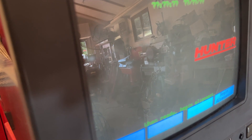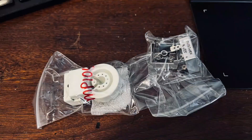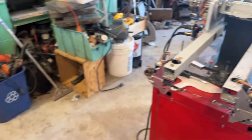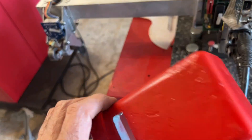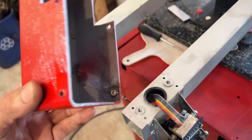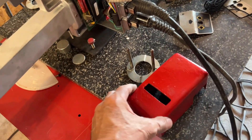I love this CRT - the CRT is pretty crisp and very much not burnt at all. The thing I did to it is I replaced all the capacitors and I did replace a flyback transformer, and now it's like new again. Of course I cleaned up all the sensors and I'm doing the covers - I already painted them. And I had to 3D print this one - she goes right here. The reason is the original one is all cracked. So I did 3D print this one and painted it. It's a little slightly different than the original one.